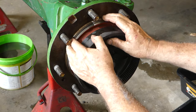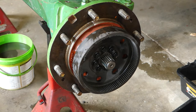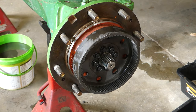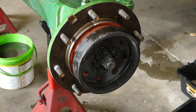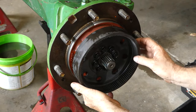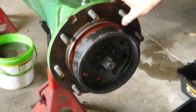Now there's an o-ring here. This o-ring actually seals the hub — seals the planetary gears, the housing onto the hub — so the oil doesn't come out. We'll just give that a bit of a wipe around, then get the o-ring. The o-ring for this is Sparex S7773. So we put the o-ring in the groove there. Make sure around the housing here is nice and clean for the old piece to go on.